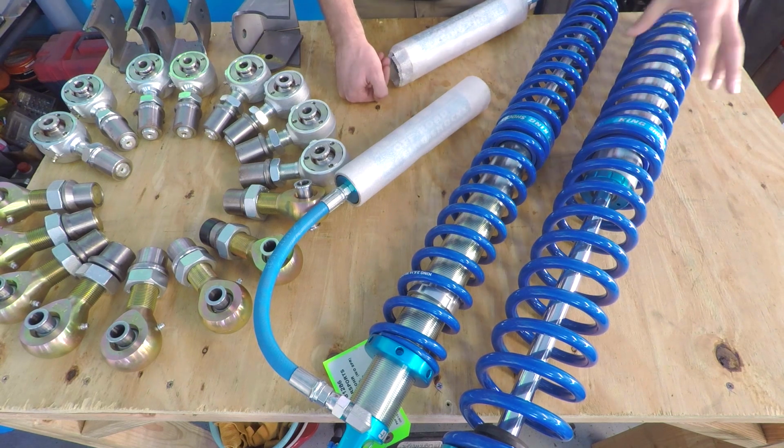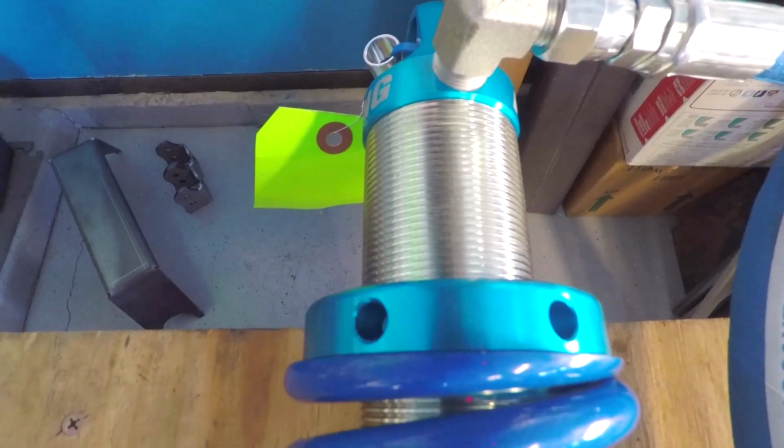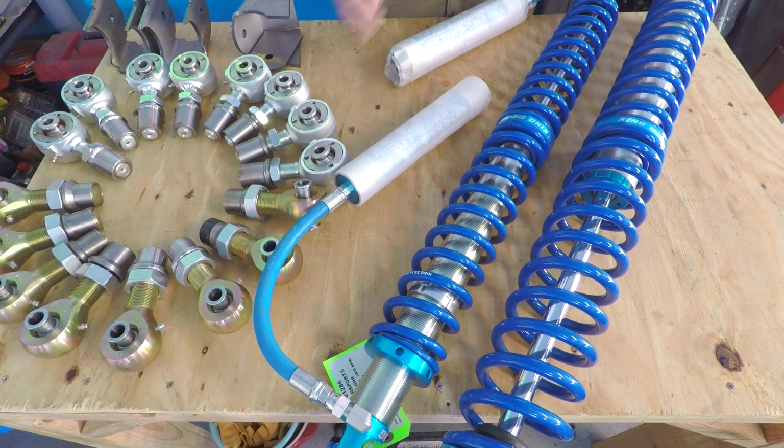It's going to be riding on the tender spring or the upper spring in most modes of travel. Whenever we start getting some compression on that side, the slider is going to move up the shock, contact the stop, and then transition to our second rate, which is usually the heavier mainspring. So as we go through travel, it is going to get stiffer as it gets closer to full compression. That's going to help keep the smaller bumps nice and soft, and then if we hit a big bump, we have some extra spring at the back end to prevent a massive shock load onto the truck.